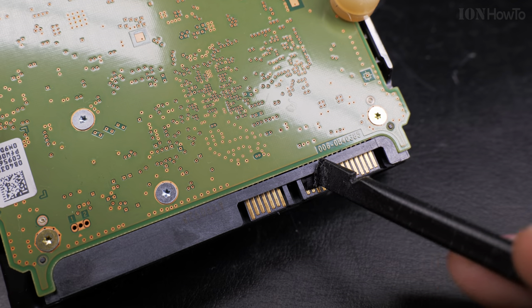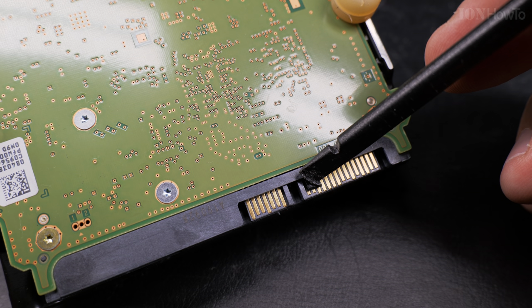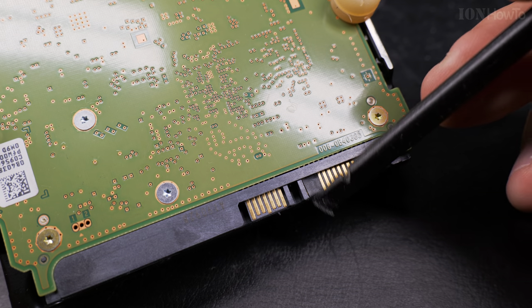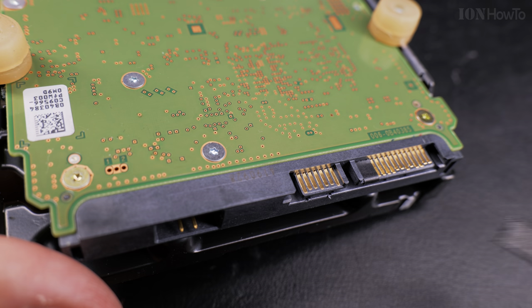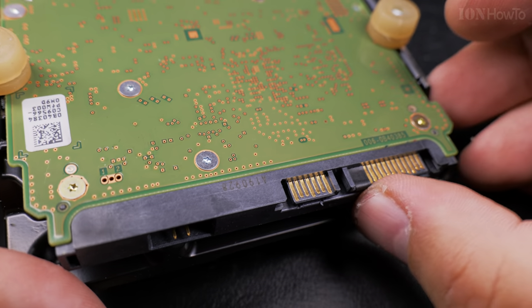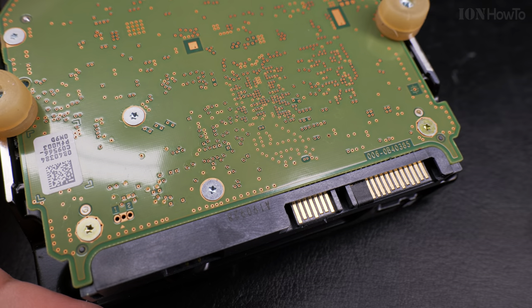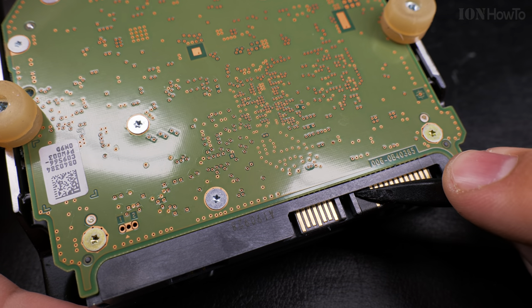This tape is very cheap, so you can change it anytime you like. Normally I don't remove the hard drives from the computer. If you need to unplug and plug the cables a lot of times, you can use a SATA to Molex adapter. Be careful that you use one that is crimped, not molded, so that you don't have a problem with SATA power failure.